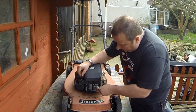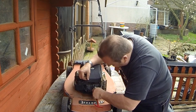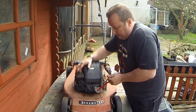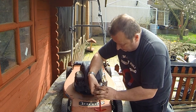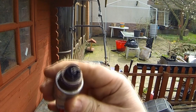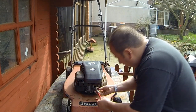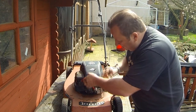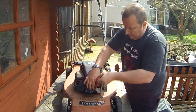So much for putting a new spark plug in — I've actually run out of spare plugs, so I can't put a new one in. Let's get this old one out and have a quick look at the condition. I've never had this out — I know I put a new diaphragm and gasket in once. The colour looks very nice, a sort of charcoal grey, and the gap looks okay too, so I'm going to put it straight back in. The one problem I did have once was it hunting up and down, which nine times out of ten means a fuel problem — usually the gasket and diaphragm.